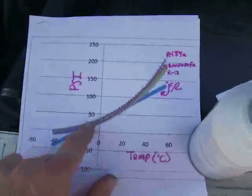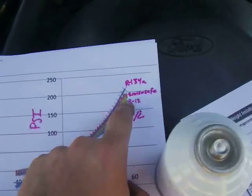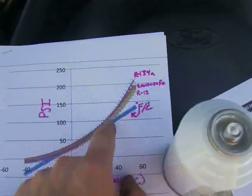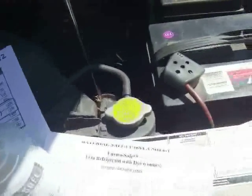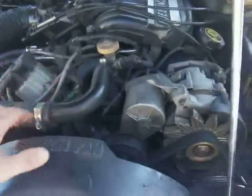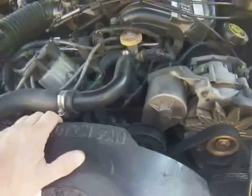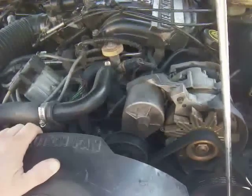EnviroSafe has properties similar to splitting the difference between R12 and R134A across the entire pressure curve. One issue is that it is a flammable refrigerant — it's a hydrocarbon mix, I believe propane-isobutane or isopropane. However, when you consider the fuel already in the injector manifolds and all the other flammable agents under the hood, the amount of refrigerant and its diluted concentration if it were to leak is minimal by comparison.